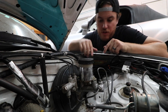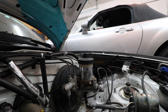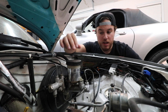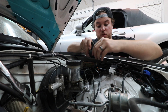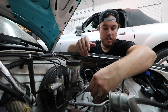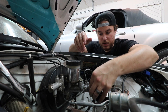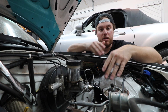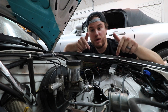I'm just going to push on the brake pedal and you'll see this entire thing flex a little bit — let's try it out. It was flexing a little bit slightly; some cars are a little bit different, but mine is definitely still flexing. And to help that flex is where this brace comes in. It just sits right on top of your strut tower, and this little piece is slightly rounded so it maneuvers and pivots — you can put it directly on the master cylinder right here and it braces up, so it can't move back and forth. In theory that should give you a better pedal feel and make the braking that much better.